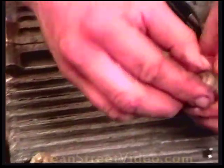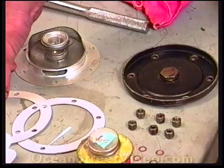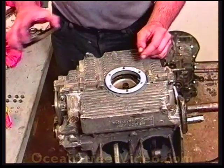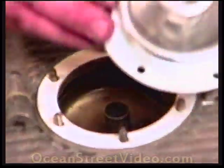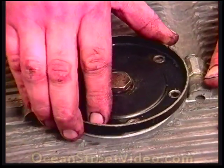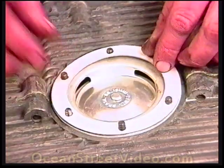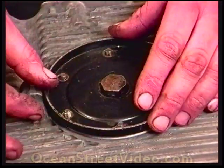These little crushable O-rings — the kit will only have one, so you may have to reuse an old one or buy an extra one at the Volkswagen shop. Never put any glue on these gaskets, because they'll be very hard to take off when you change the oil. If you have a hard time slipping them over the studs, take your sump plate and just push them down flat. This is the appropriate sump plate for the dual relief engine — it's got a slightly bigger hole than a single relief. Put absolutely no gasket cinch on these.